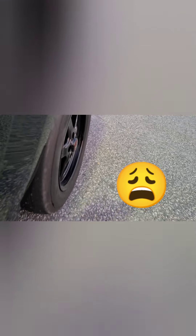Check this out - I think something in my rear end is broken. I'm trying to reverse, turning full lock, and it doesn't want to go - almost like a limited slip, but it's locked. I let go of the clutch and it rolls me forward because it's binding, almost like spring tension. And if I go forward we're probably gonna hear a big clunk - there it is, she's clunking. Making some noise now with full lock to one side.